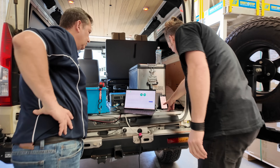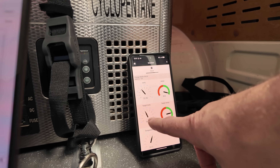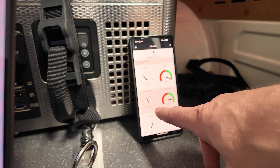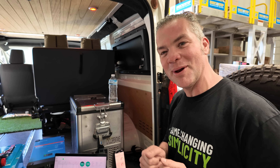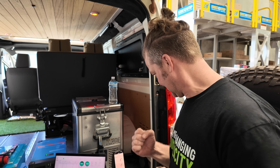Right now Haine is very excited. The battery is now in control of the alternator. The battery is sending its set of instructions to the alternator controller — saying, 'Hey mate, this is how I want to be charged,' because the battery is the one that knows. And it's working.